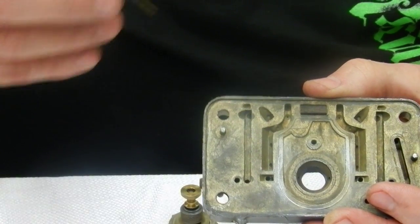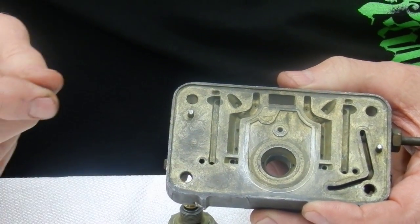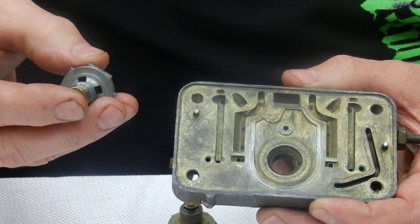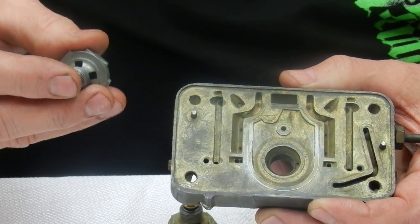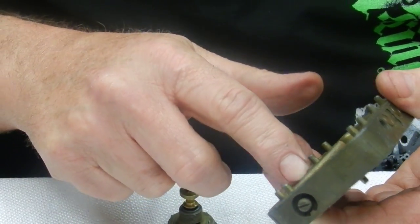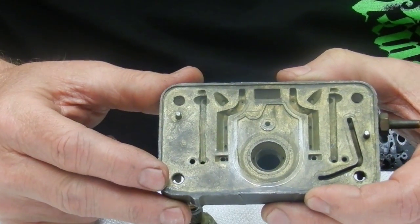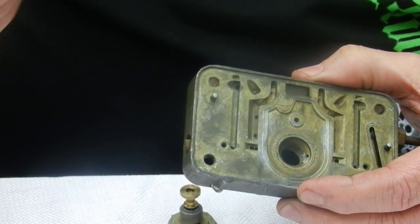That's why the power valve has nothing to do with the idle circuit. When fuel is flowing through the jets and coming through the main well, it'll run the carburetor at any steady speed. But when you accelerate, you've got to have your accelerator pump for that first initial burst of fuel, and then the power valve opens up and flows almost like another set of jets to enrich the mixture. We don't lose any signal at the jet when accelerating because the power valve is on the same exact circuit.